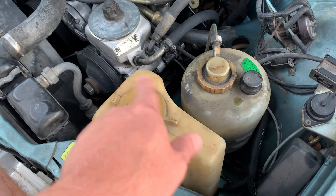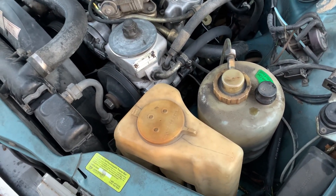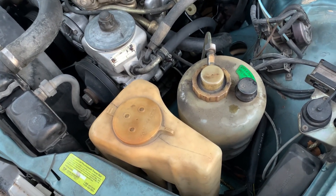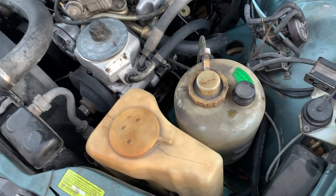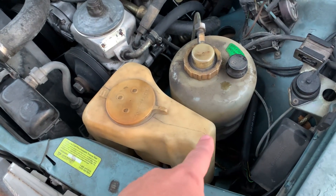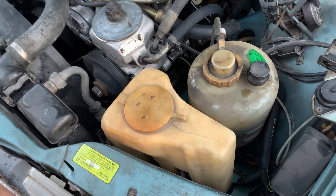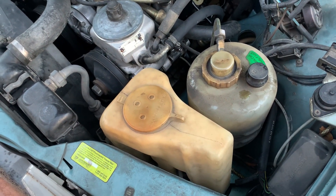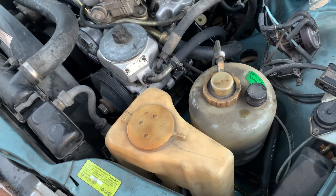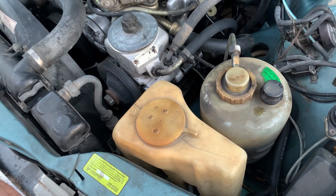Check your hoses as well — that's a failure point. Just look for leaks; if there are no leaks, hoses are probably fine. If you're servicing the system, go ahead and change that filter out. For changing fluid, you can suction the fluid out of the tank and put in new Mercedes-recommended SLS fluid. I'll put a link in the description — there are a couple of different approved manufacturers they recommend.